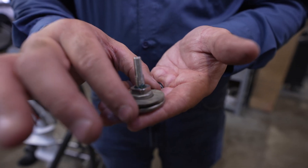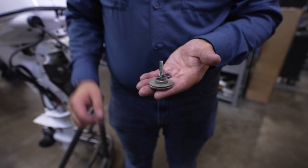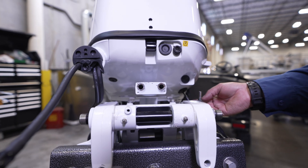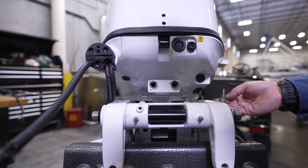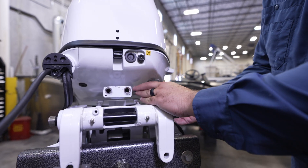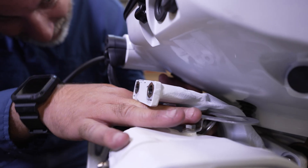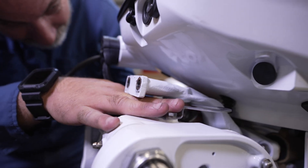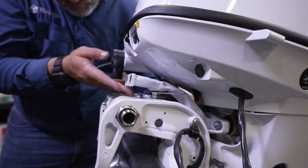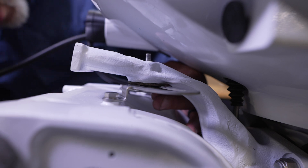Select one of item 4, a disc, and insert it onto the friction lever bracket. We will refer to this piece as the stud bracket assembly. The motor should be in a centered position. Select the other disc and align it with the steering bracket hole between the steering shaft and the plate. Insert the new stud bracket assembly through the plate into the steering bracket hole from the bottom, making sure that the keyed end is inserted first. You should now have both discs touching the plate.